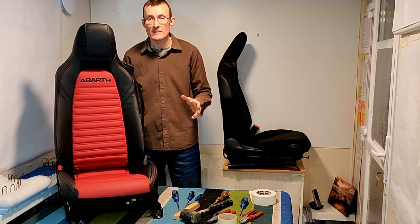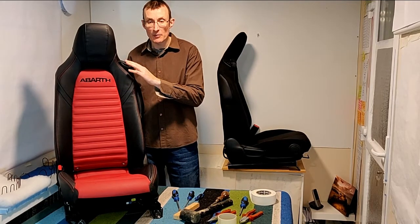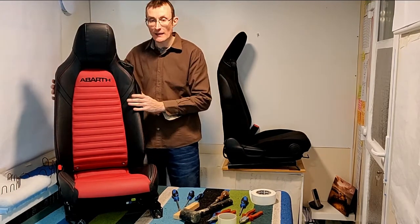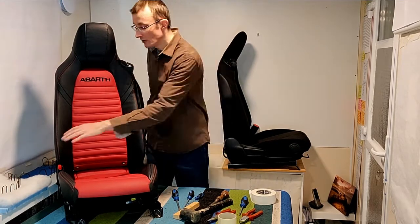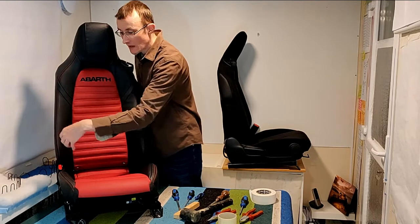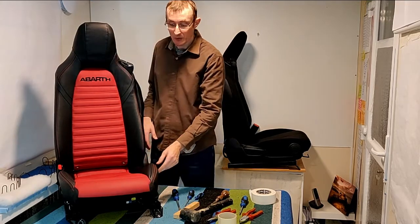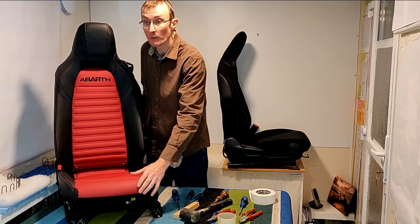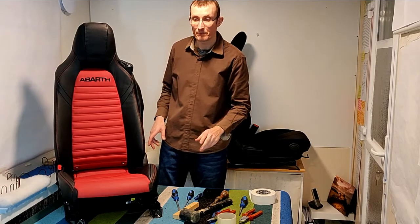Now I'm going to take this in sections. We'll go through taking off the seatbelt clip, we'll look at taking off the side seat adjust, then we'll remove the back cover and we'll explore where the airbag is. We'll look at taking away the seatbelt wire because that feeds through the side of the seat cover. We'll remove the bottom cover, and then last but not least we'll consider the driver's side leg support because that has an additional dial on the side of the seat for adjustment purposes.